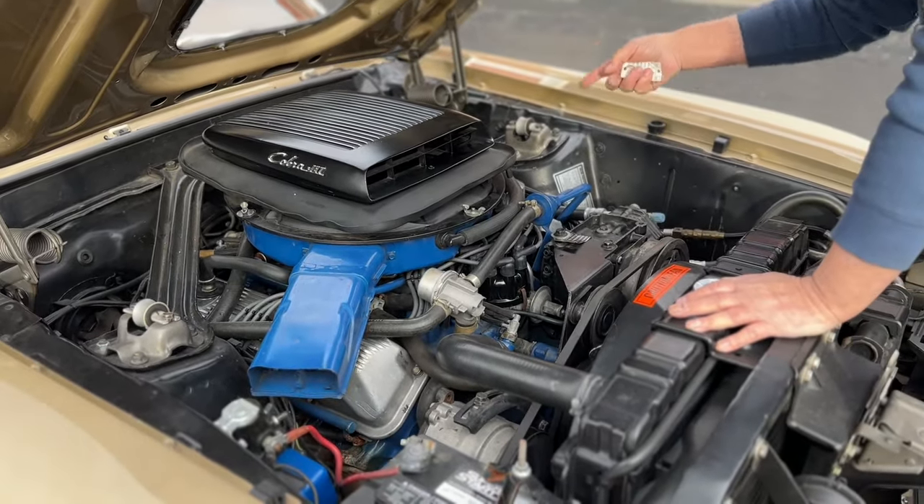I'm not trying to squeal the tires on this thing — it's just almost impossible not to. It does have a Detroit Locker, so whenever you turn the steering wheel you'll notice both rear tires are hooked up equally. Going around a tight turn you'll feel one skip a little bit — there's nothing wrong with the rear differential. That's what a Detroit Locker does: it's made to go in a straight line and lock everything up solid whenever you drop the hammer, giving you two equal tire marks.